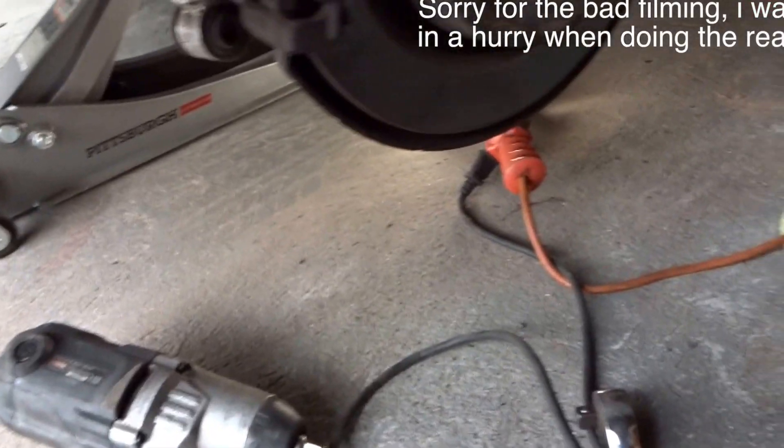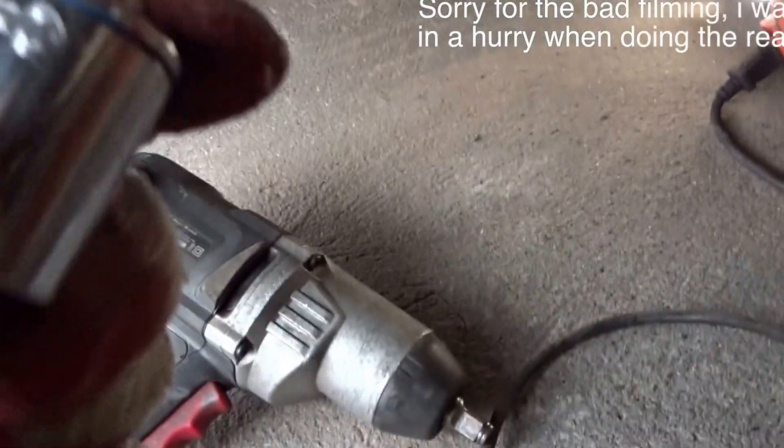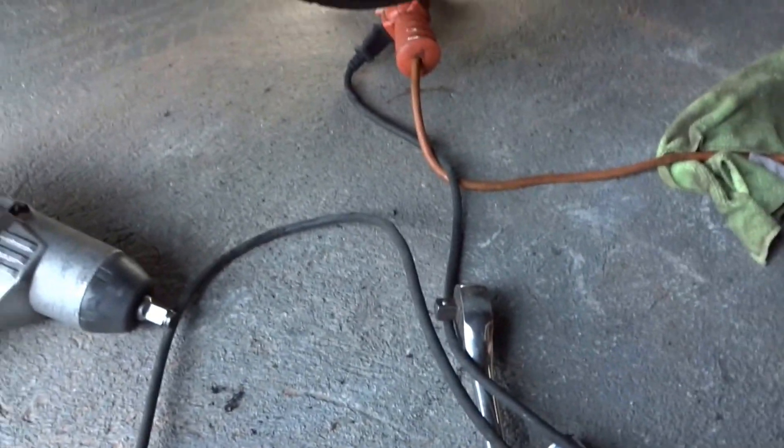The front is done — now we're on to the back. Once we do the back we can readjust everything and make it nice and even all around. For the rear suspension, just like the front, jack the car up and put it on two jack stands in the back. First thing you got to do is disconnect the shock — it's an 18 millimeter bolt located right here. Once you loosen it, it's going to drop a little bit and then you can push down and remove the stock spring.